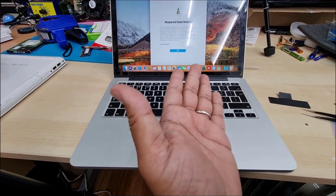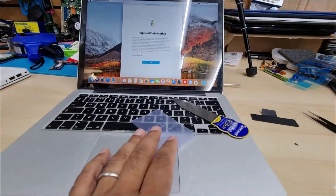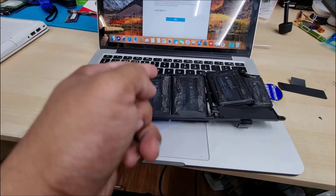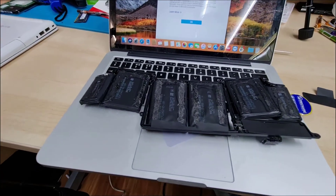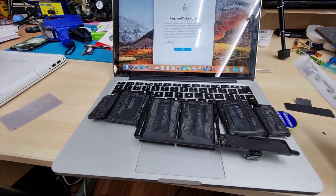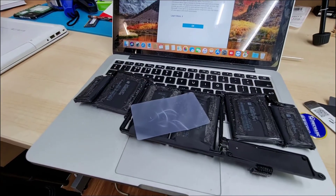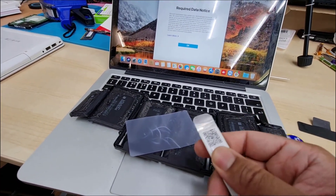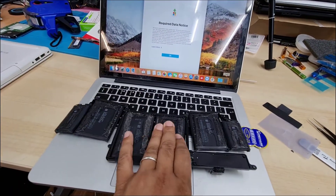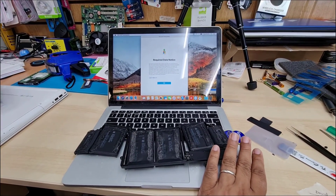Once you replace the battery, make sure you discharge it down to 10% and then fully charge it — a genuine charger is much better. If you repeat this cycle twice it's brilliant for battery health calibration. As you can see, the old battery was bubbly, which is one indication the battery is damaged. A plastic tool or plastic card is much better for cutting the adhesive, but I used a metal pry tool to make it quicker and easier. If you still have any questions, leave them in the comment section. If you like the video, hit the subscribe button — thank you so much for watching, I'll see you in the next one.